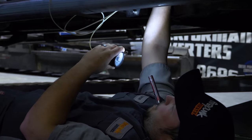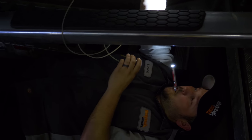We've got a rail surge that is just relentless. We swapped the modded FCA for a stock FCA and turned the lift pump pressure down as far as it would go — down to about 14 psi — but when we unplug the lift pump the surge goes away. So we're going to clip the actual regulator spring down to get the lift pump pressure to around 8 or 9 psi and see if we can get it to go away. Hopefully we can get the surge smoothed out with the Air Dog and get this thing wrapped up.